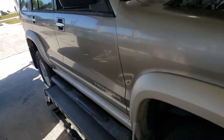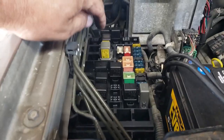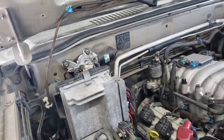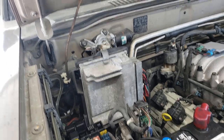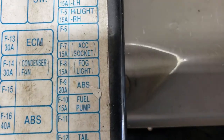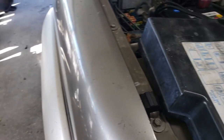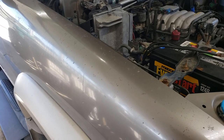What I decided to do was disconnect those lines at the fuel filter. Over here is the fuel pump relay — third one up is fuel pump relay power. I started the vehicle, let it run, pulled the 15-amp fuse F10 — as you can see here — let the car die, which kills the fuel pressure. Then I'm going to go under there and disconnect those hoses and see if I can reroute them a better way. The stuff upstairs may all be for naught, but you'll see me in a minute.